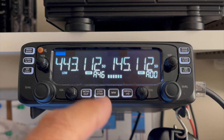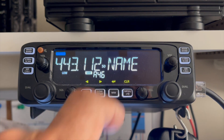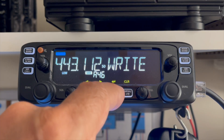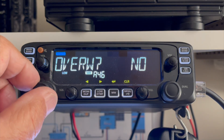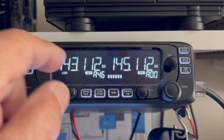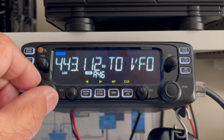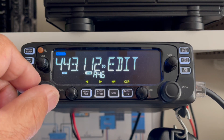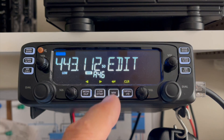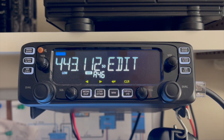Now I have to do a memory write. I believe there's a short pause and a long pause. So I hold it down until the word 'Name' comes up. Then I scroll until it says 'Write' and I hit that. Then it asks 'Overwrite?' and I'll say yes and hit that. Now when I move this, it's gone. If you do a little short touch on the memory write, you have different options. I think this can be confusing for some, but you have the same button — there's a short push and there's a long push — so you need to differentiate the differences.